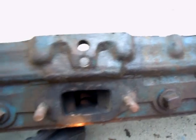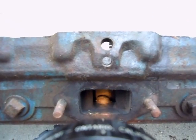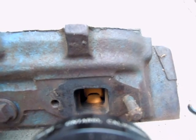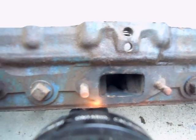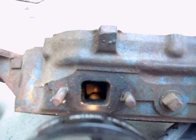In the ports here, they've got that hump thing — each one of these has a hump. A coolant passage runs through there, and it helps get rid of the heat in the head much quicker. It's kind of a strange design.